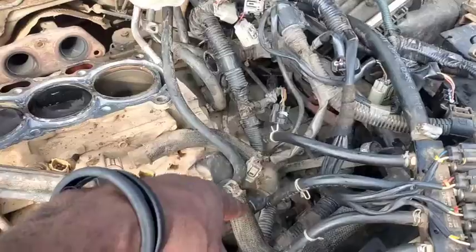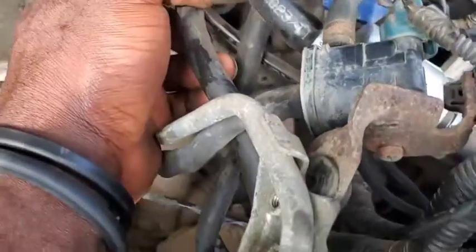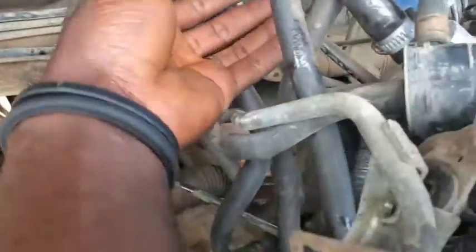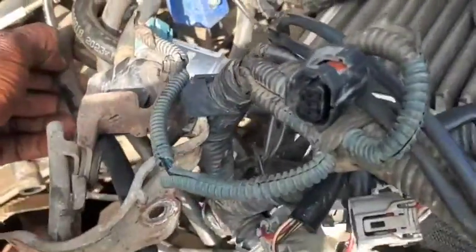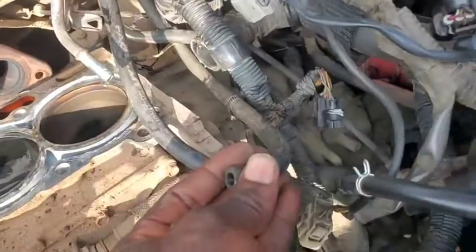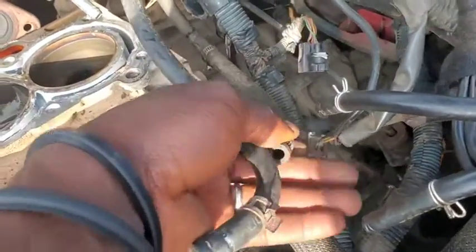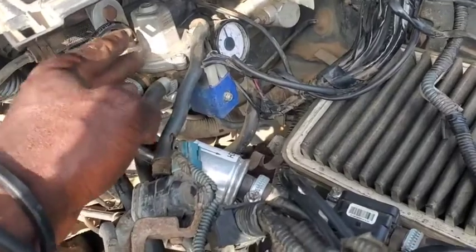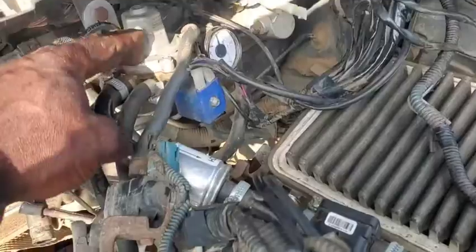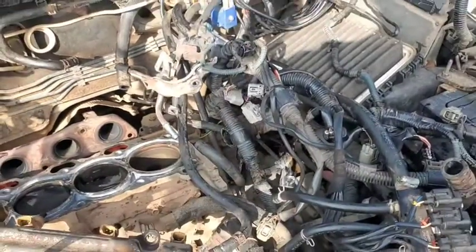The last part I want to explain is these two pipes here. We have one going in here and another coming from here. This is where you tap from the hot coolant that is being used inside the engine — that goes here to transpose the liquid CNG into gaseous CNG. Without this, you are going to get a lot of liquid coming back into the engine. I hope you guys understand it. Thank you for watching. Bye for now.